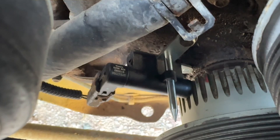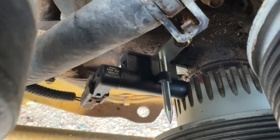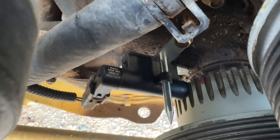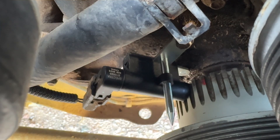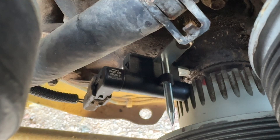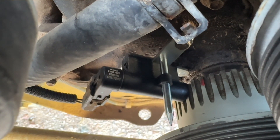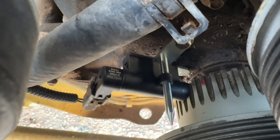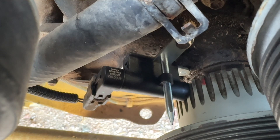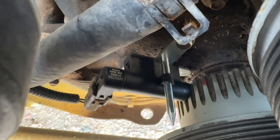This is what it's going to look like when it's done and completed. Once you get that guide pin in and put one bolt in, the other one goes in super easy — you don't have to start one and then work the other one in. You can actually tighten one down and then go to the other and it's already pre-aligned. Hook up your electrical connector, make sure it locks into place, and that's how easy it is to install a crankshaft position sensor on your 1995 4-liter Ford Ranger.